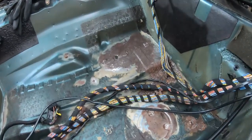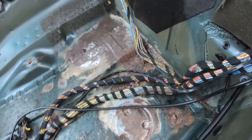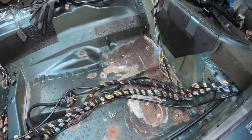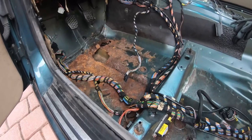So it seems like in the rear it's mostly just surface rust — it didn't look like it got too deep. So for the rear, I'm planning on just wire wheeling it and then spraying on some primer to stop future rust. And then for the front, it's a lot more damaged.